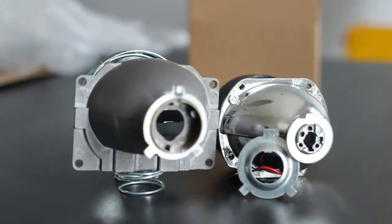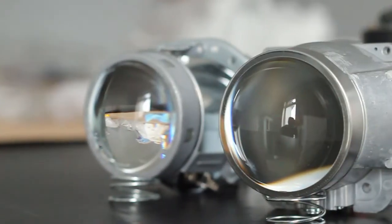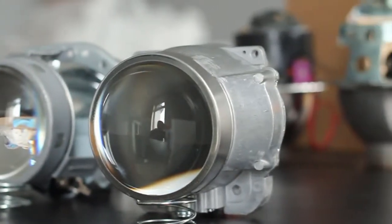Pretty much plug and play. Something like our FX Pro or EVO XR projector will require modification to your headlight, mainly due to its size, and there's no adapter for any of the bulb types out there. If you have any other bulb type like an H1, H13, 9006, or 9007 — anything aside from an H4 or H7 — modification will be required.